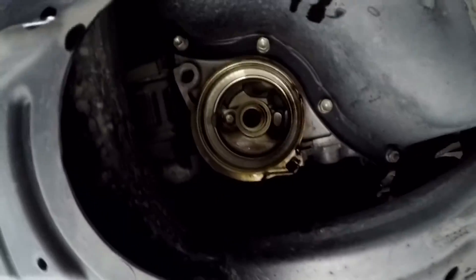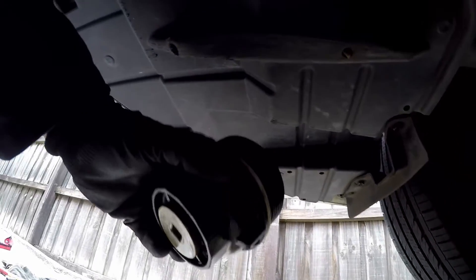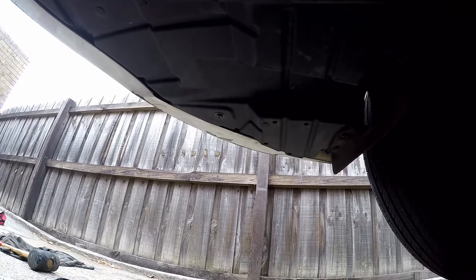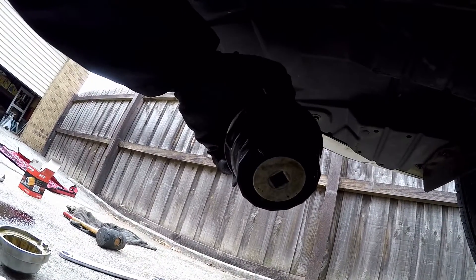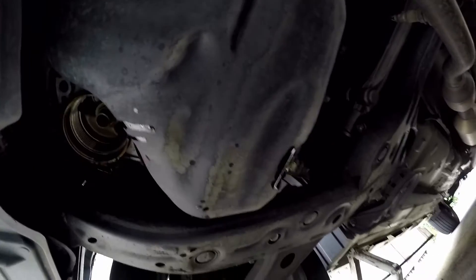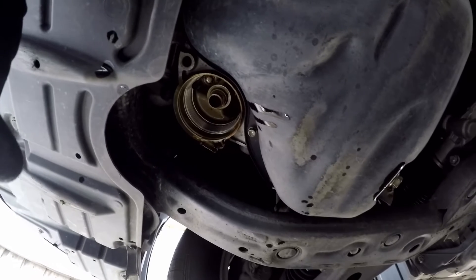As you can see, that's where it's going to screw back into. The canister itself is some sort of heavy-duty plastic, so don't go too hard on it — it screws in manually at first, then just use the little tool to finish it off. That's what it looks like with a brand new filter and brand new o-ring. I didn't undo the drain bolt on the cap. I've put the sump plug back in — I'll tighten them both up, spray them with some degreaser, and wash it all down. Fairly easy.